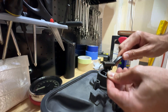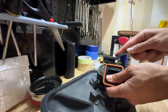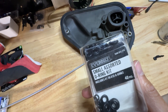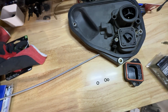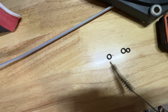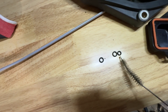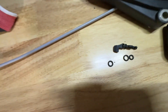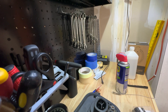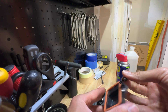I scrubbed down the latch because it was a little bit gunked up around the o-ring. With the o-ring, you don't need anything fancy. I went to my local parts store, got a universal pack — you'll see the original o-ring there on the left. I pulled out two: one that matched it and one that was smaller, and I went with the smaller one. I did verify after I put it in that it did seal and did help with the sliding.